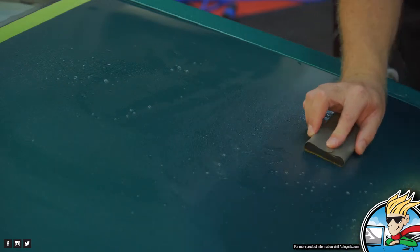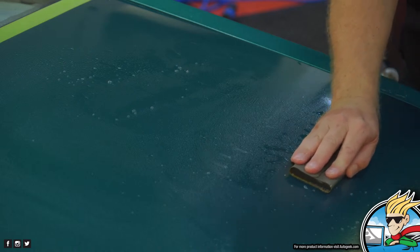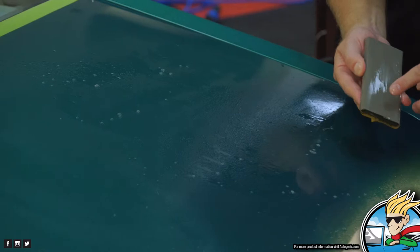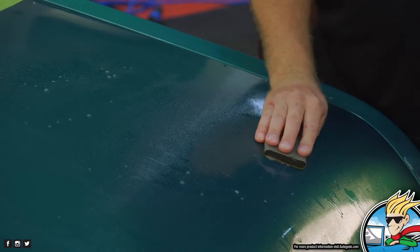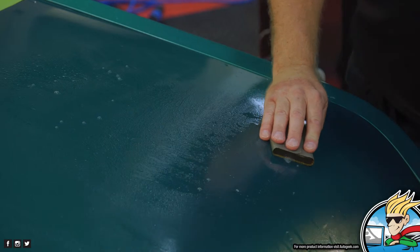When you're sanding with a soft block, and that's what this is called, you don't want to run the sandpaper perpendicular with the direction that you're moving it, okay? Because you're going to get deeper sanding marks from the edges of this block. So what you want to do is just turn it a little bit. That's called cant. I think it's K-A-N-T, okay?